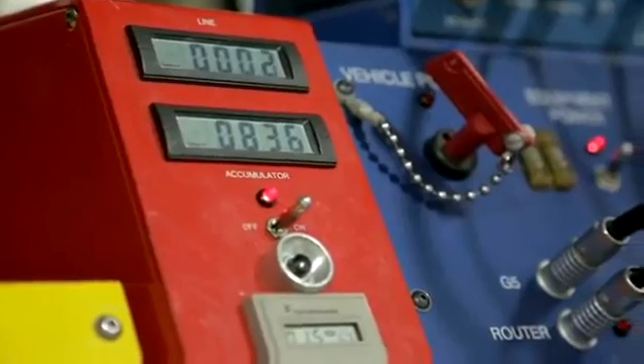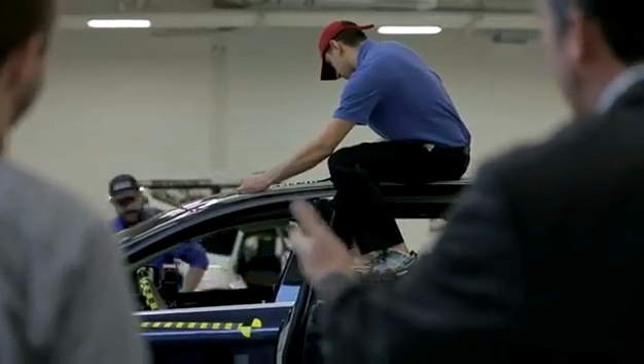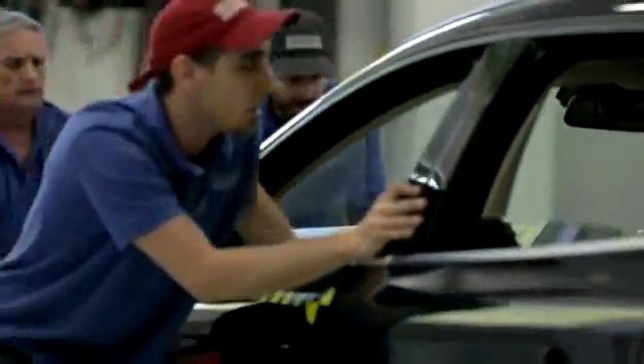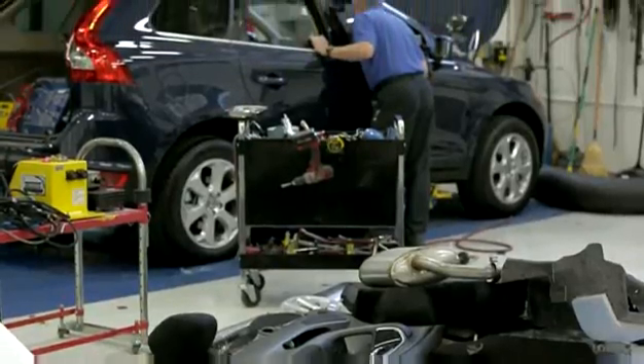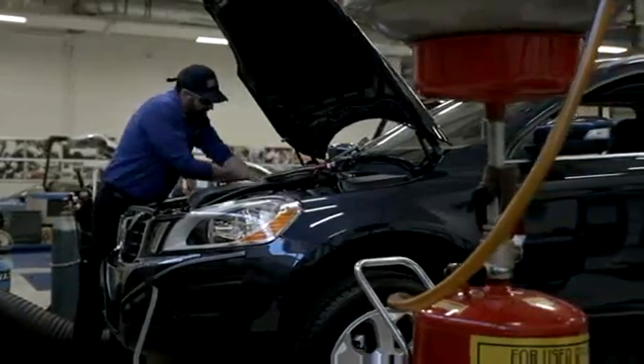It's always a nervous situation before the test. It's incredible the amount of work that goes into a crash test — for the milliseconds of the crash, there are days of preparing. When a vehicle comes in, one of the first things we do is document its pre-crash state with some photographs. Then it goes straight into our vehicle prep area, where we start draining fluids from the vehicle, and then we also start measuring the vehicle structure.